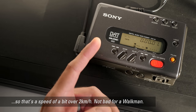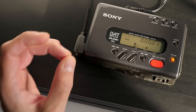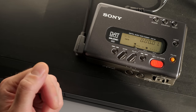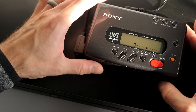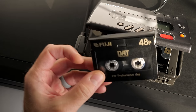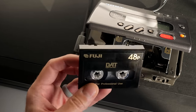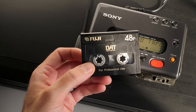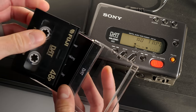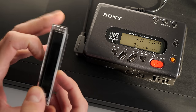Because of the way it records, DAT goes way slower in terms of tape speed — something like a little over 8 millimeters per second during normal play. Compare that to cassettes at almost 48 millimeters per second during normal play. What all that means is that DAT tapes physically don't need as much tape, which is partially why they're so much smaller. And because they need less physical tape, fast forward and rewinding is just so much ridiculously faster. That's one of the major pain points of cassette — how long it takes to get anywhere on the tape.